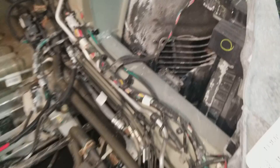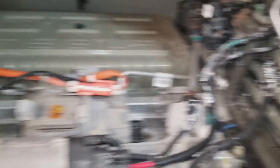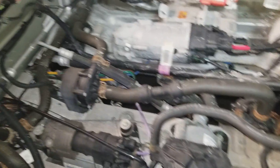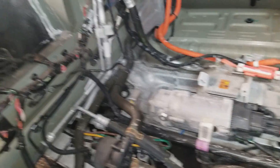As you can see, one of the clips decided to stay behind. That is a general rundown of the basic stuff. You've got your coolant reservoir right there, a couple of diverter valves here and there. You've got your radiator right here. The radiator only cools the coolant coming from the drive unit. What cools the coolant for the battery is the chiller.